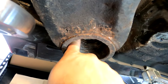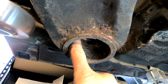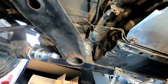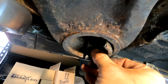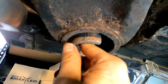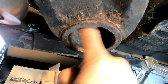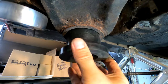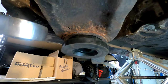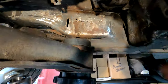I had to torch out the center piece with a MAP torch and wiggled it out with vice grips, then used a Sawzall to cut two slots on the remaining piece — basically a metal liner with rubber inside. So basically two large chunks of metal on each side — I cut to split them and worked them out, then used an air hammer and die grinder to clean this up. Now the new poly bushing should slide in there perfectly by hand, and there's a top hat piece that's your spacer.